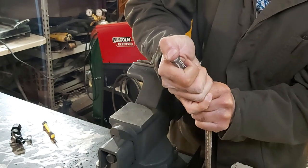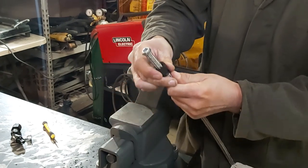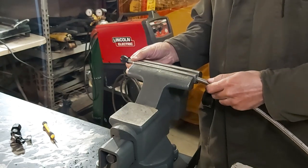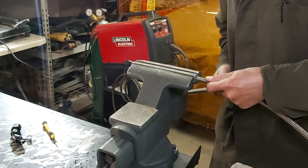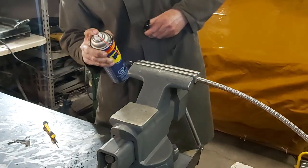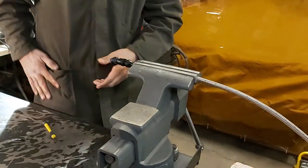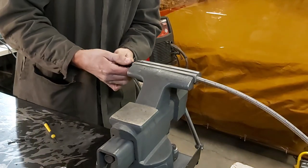It is now seated all the way against the inner lip — that's good. Then what you do is you just pull this forward so it goes around; you kind of have to twist it. I'll put this back on the vise just to make it easier. Now this section here slides into the PTFE line — lubricate this so it slides in. Then you start turning the nut on; you just got to get it started and that's the trick here.